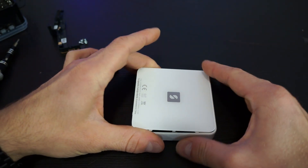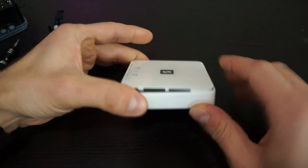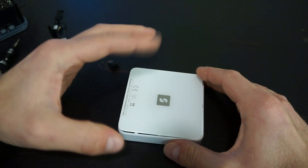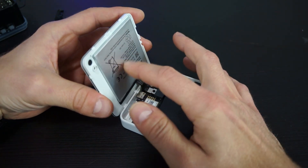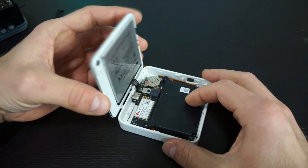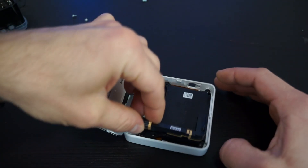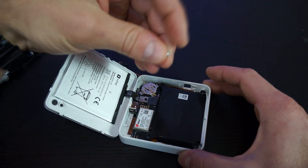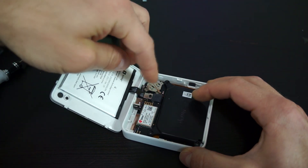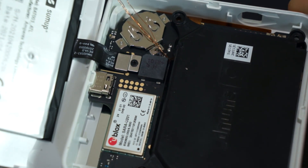Let's now take a look at the three issues. First, we can open up the case quite easily via an exacto knife — no screwdriver needed. There are clips all around which are openable without any damage, but you need to be careful. After that you can lift up the backside where the battery is glued in, along with the Qi charging coil — so wireless charging is possible. Inside there are two antennas, and a backplane screwed in via Torx screws. It's quite tightly packed, with a wireless module, a few test pins, and a small battery most likely used to hold the secure keys.